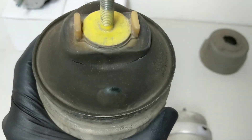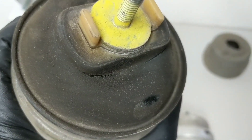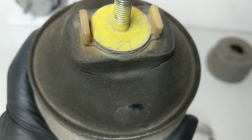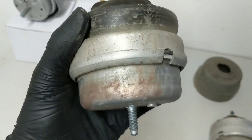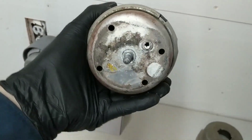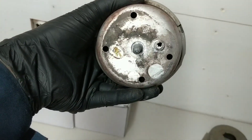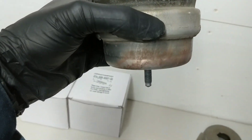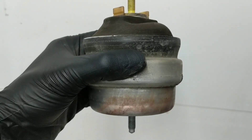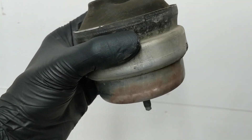Here's the passenger again with the cover off. This car has 109,000 kilometers on it, and there are some very minor cracks in the rubber material. And here's the number one offender — this is why we're doing this at all. This is the mount that leaked, and you can tell it came out from that particular position. Where it was on the bottom of the car, this was the front and this is the cabin of the car, so the backside seems to have leaked. It's also worth mentioning that this one sits the least flush out of the two OEM ones — it's actually angled quite a bit.